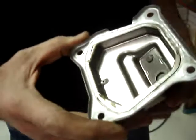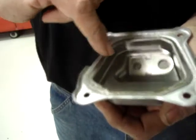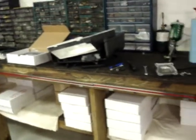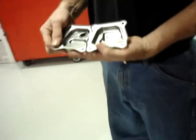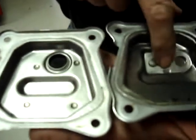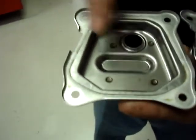This is a California approved generator. You notice the valve cover area on this one has a plate for the breather cover. Let me show you the difference. This is the non-California approved. So if you've got the type with the purge tank and the extra hoses along the side, you'll have this valve cover. If you've got a 48 state or old style, you'll have this valve cover.